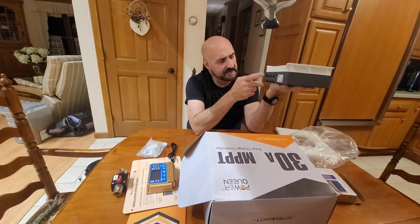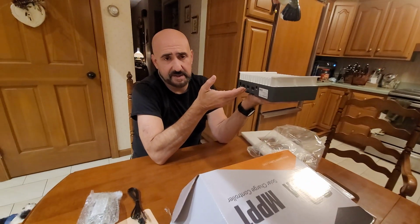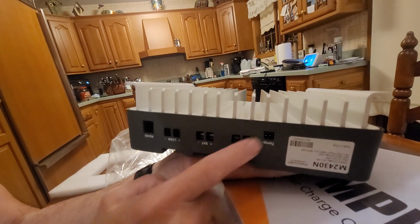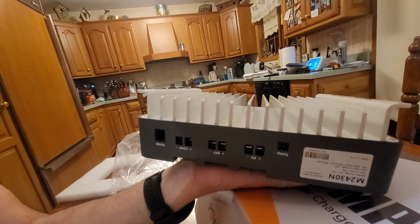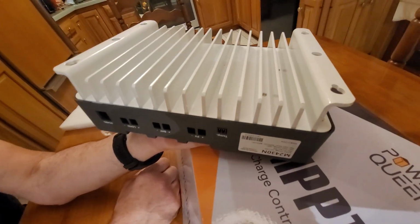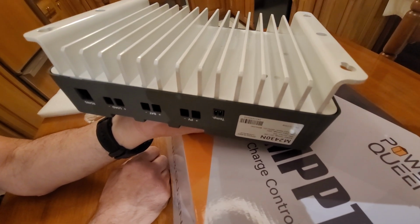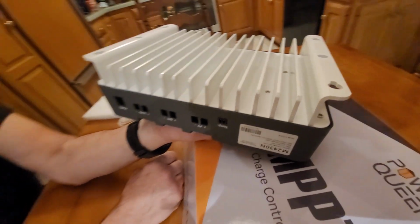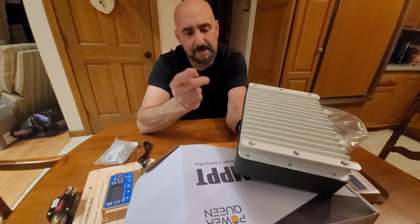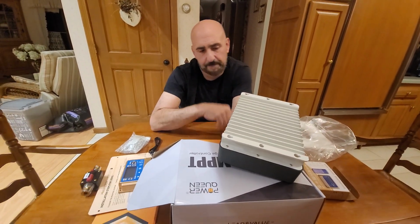And the rest of it is, you know, simply the panel and load. I'm not going to be using it for load because the inverter is going to take more than 30 amps at its full 4,000. So I could put a light on this if I want. I was thinking even maybe a night light for outside the camper where when it's, you know, real dark, it pops on an LED around the area where you step up. Just so you have some step and you don't have to go flipping on all the lights on the outside of the camper, but you could have some step lights that come on at dusk. So that was my plan for that. Maybe use an amp off of this side, if that. It's LED, probably milliamps. But that's the plan.